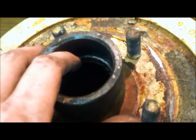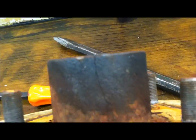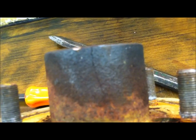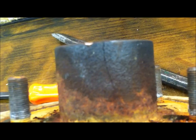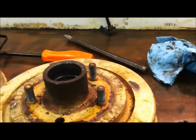That's that for this part of the video. In part two we'll be putting everything back together. I'll show you something I screwed up here — I cracked that. You can see that somebody had heated it up once before, and I did that hairline crack banging that race out, so you've got to be really careful. I don't have the capabilities of welding cast here in my garage, so I've got to take it up to the shop I work at. I'll have to preheat it and use a rod called Nickel 99 to weld it all back up. I'll see you in part two whenever all my parts come in and that's welded up. Thanks for watching guys.